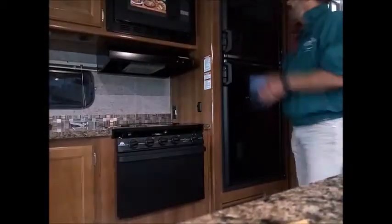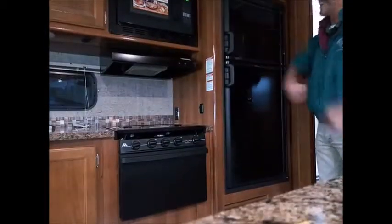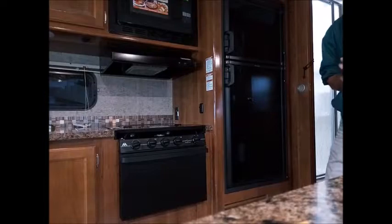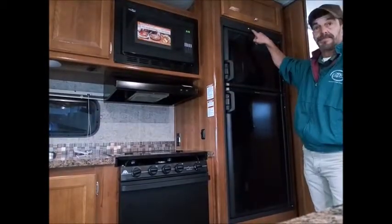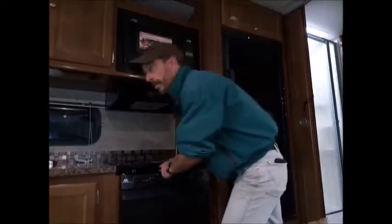So when you're in Vegas, run that one and run that one. What'll happen when you unplug from the house, it's automatically going to go to gas. The problem is it doesn't tell you that. So you go to gas. Now, if it didn't function correctly, the check light would come on. Hey, it didn't light off. Maybe I forgot to purge the tank.